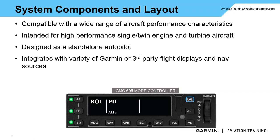This is a standalone autopilot. Compared to other systems like the GFC 500 that has to pull an AHRS or attitude source from a different box, the GFC 600 — specifically the 605 — has its own built-in AHRS, so it doesn't need to pull that information from anywhere else. We can integrate this to a number of Garmin displays as well as some third-party displays, including G500, G600, or TXI, and even potentially a G5 or GI275, though capability will vary by equipment.